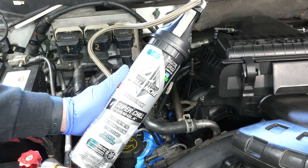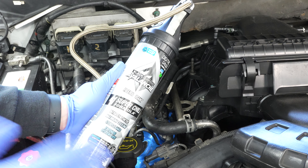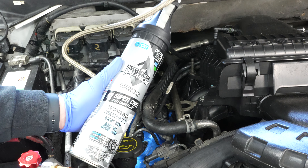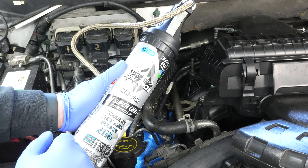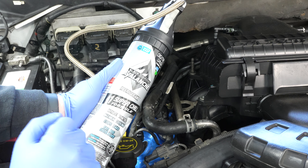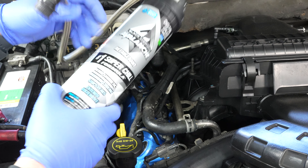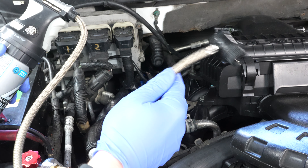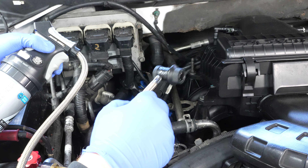What I have here is a conventional can of R134A, which is typically the refrigerant older cars use — by older I mean older than 2021 or 2022. The standard changed around then to 1234YF, but if you're watching this video, R134A is typically the refrigerant you'll use. Before connecting, I like to purge the line — because if there's atmospheric air in it from sitting on a shelf, you'll put air into your system, which is a problem. It won't work.